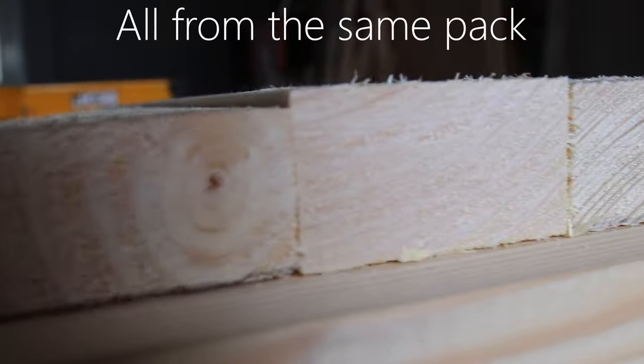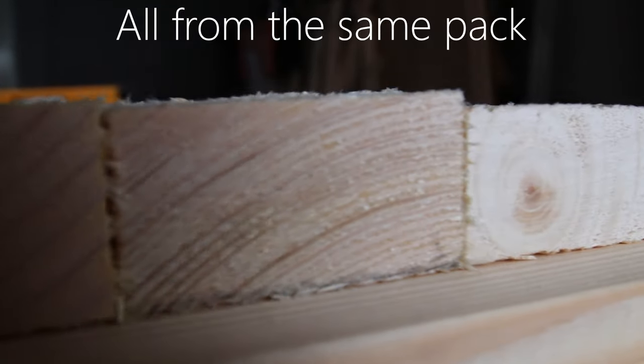The final thing that I did yesterday was, there was a floorboard loose ever so slightly, and it just kind of rocked. It's basically because the battens, although I've bought them in a pack, because they're not planed, they're kind of rough sawn, and this is the blue treated timber, they're not all the exact same size. So where I've laid the flooring over the top of that, it rocks slightly. So what I've done is I've screwed it down just so it rocks a little less, but there is still a bit of a bump there. It's unavoidable unless I ripped up the whole floor. Just gonna have to live with it. Likelihood is we'll probably tread it down and it'll become less noticeable over time.